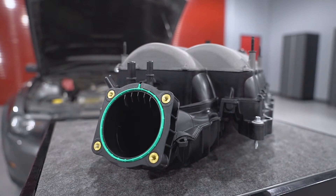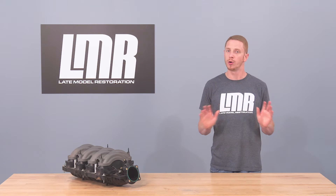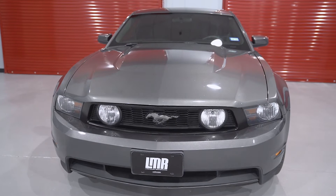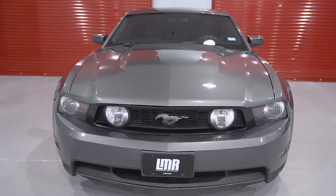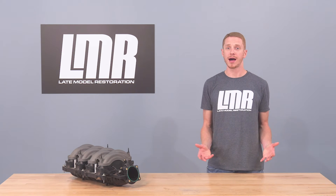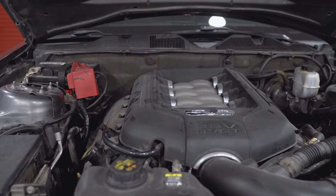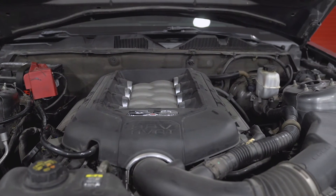For the sake of this video we are going to be talking about a factory out-of-the-box 18 manifold, which means no port work has been performed. We have a bone stock untouched 2011 GT as our benchmark — it only has 80,000 miles, is a one-owner car, and is a base model MT82 car with 3.31 rear gears.